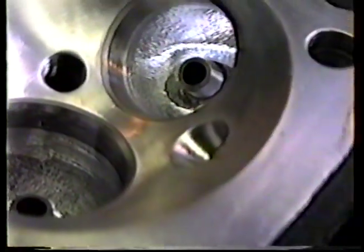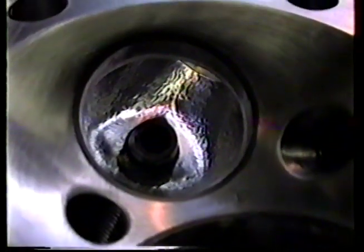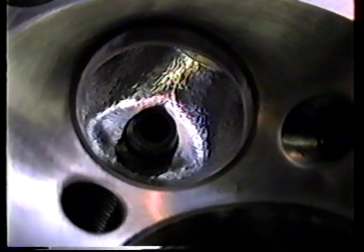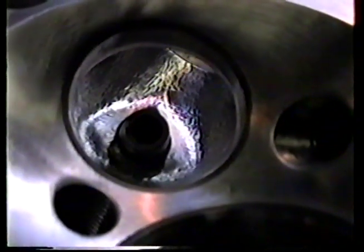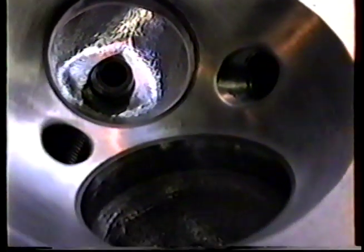Now look on down through the exhaust port from this angle. We've got these exhaust ports flowing exactly the same as the intakes up to 200 thousandths in the low lift flow area, and what that does is give the motor an extremely smooth, effective horsepower range — it really helps the lower power band extremely well. Also, you can use a little different cam in it and not even notice the difference as far as the way the things run. They run real clean with this port design.